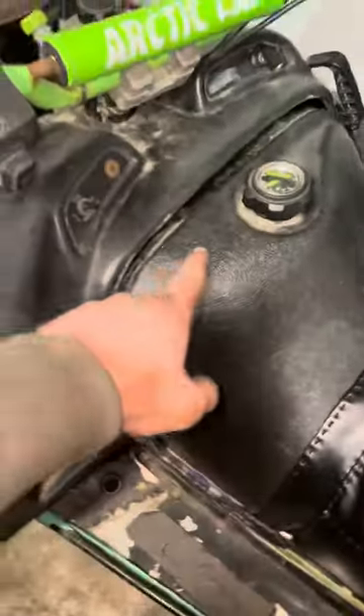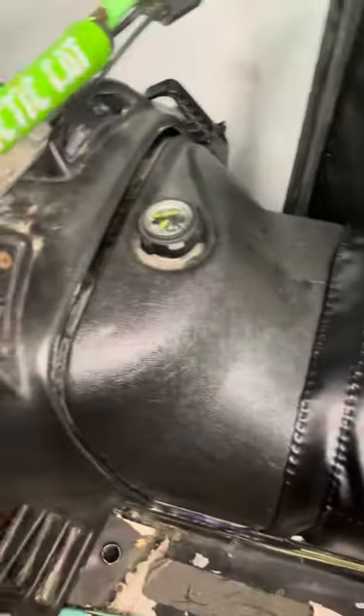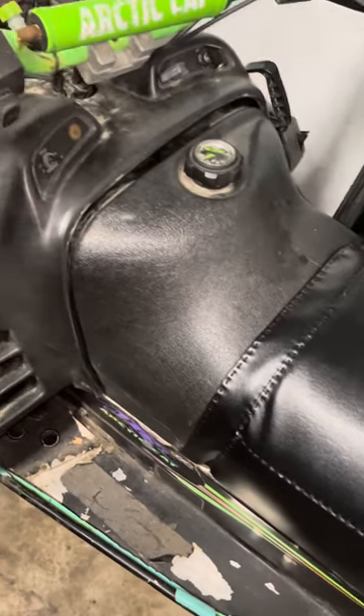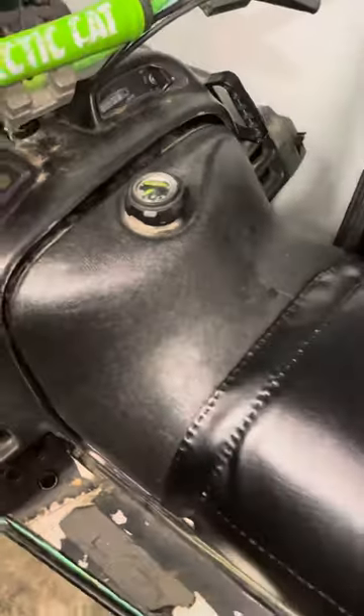Another thing you're going to want to do ahead of time is drain the tank, or at least siphon out most of it. I didn't. There's a little nub that comes out of here — there's a small fuel line, you can see it poking through the firewall right here — and then there's a little fuel filter that goes into a petcock or shut off here. I had an almost full tank, slid this thing backwards, popped the fuel line off, and went to drain it. There's like seven or eight gallons in this thing, and the fuel tank runs all the way down into here — it's actually a full compartment under the seat too, so you're basically sitting on the tank. There's a lot of gas in there, so if you can keep yourself from trying to lift up this heavy tank or spill it all over the ground, it might help you out. I hope this helps. Thanks. Good luck.